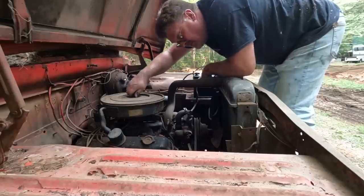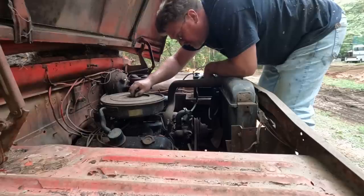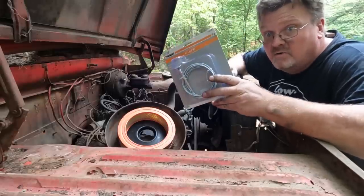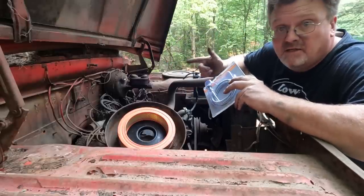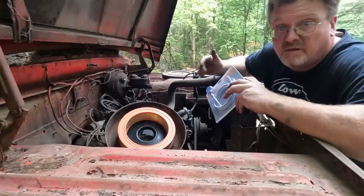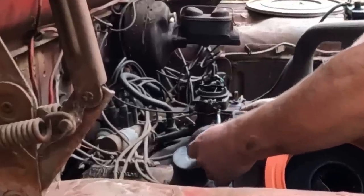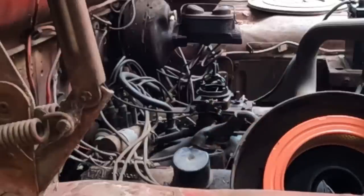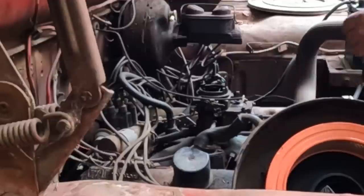So now we know those modern Chrysler starters are straight bolt in for the old style starter, and they work better. While I was buying the starter, I popped the $8 for a new choke cable. We're getting fancy here. But then I might be able to actually use the choke and it might make it easier to start rather than pouring gas in every time. Now with the old cable.